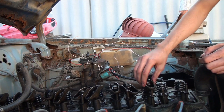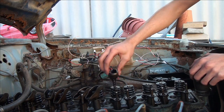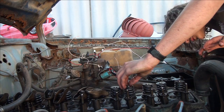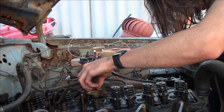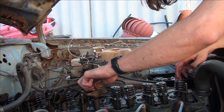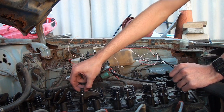I've got a little container just to chuck all my stuff in. Pretty much just take all my rockers off, chuck them in there, take my things off, put the ones that aren't broken in there and the ones that are I'll take to school to fix. Going through all my cylinders - these are all still stamped with Chrysler and UAP on them, all these rockers, so definitely original. With these valves they're a lot bigger than a normal 265, so someone's gone and modded them for some reason.